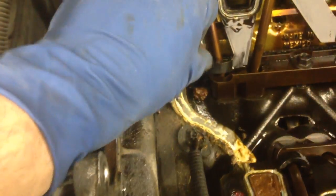This is why it's called Dex Kill. A lot of people have changed back to the regular green mixture of coolant because you don't have those problems with that. You have to change it a little more often, but if it saves you having to replace a heater core, it's worth it most of the time. This stuff gets in the radiator, gets in the heater core, gets in small coolant passages in the cylinder head, and as you can see in here, it almost stops them up completely.